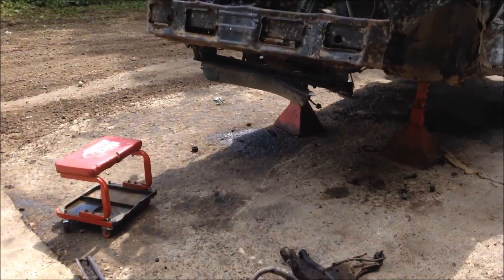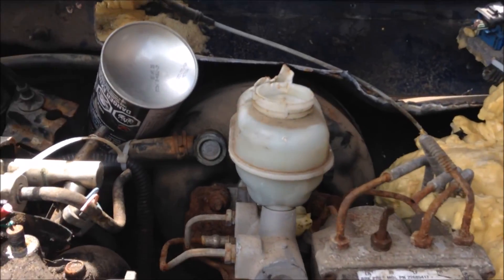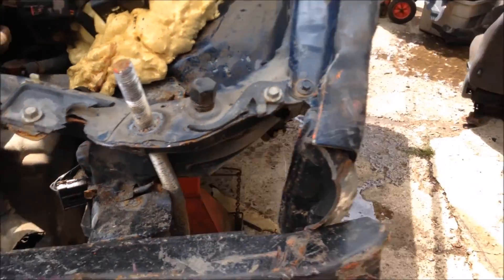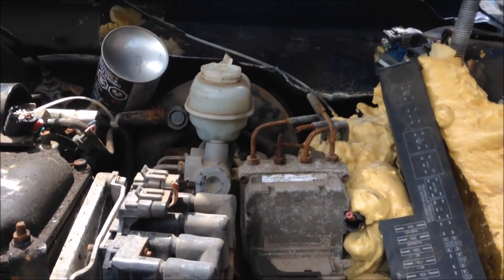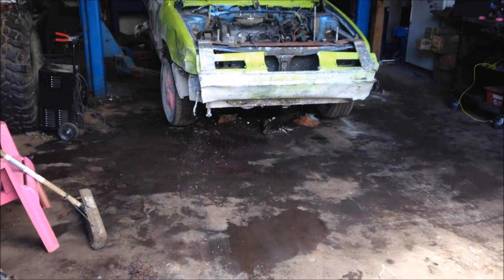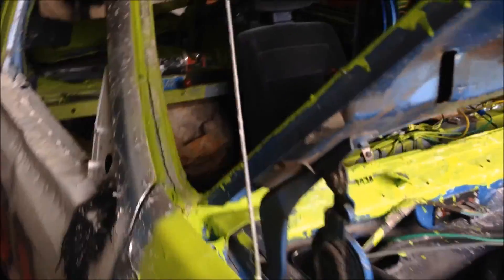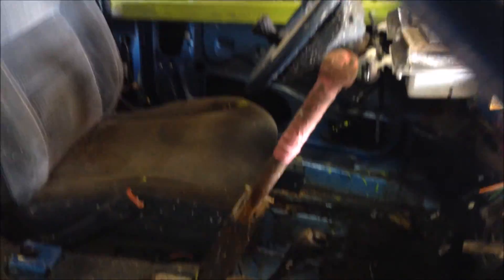My plan is to take the power brake setup out of another Sunfire — the one from Sutton — and modify it so that the hydraulic brakes off that car activate only the rear brake on this one, and rig it up to work off her hand brake setup.